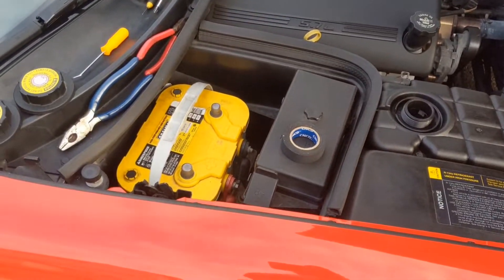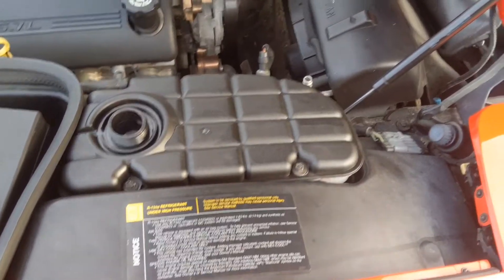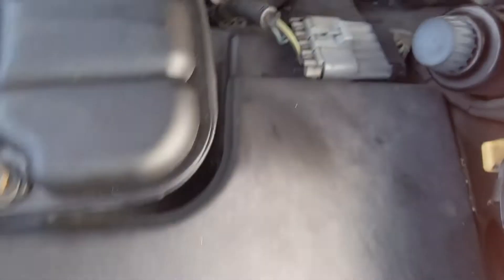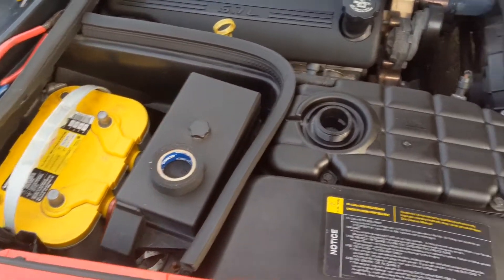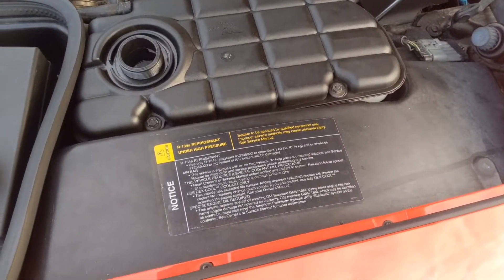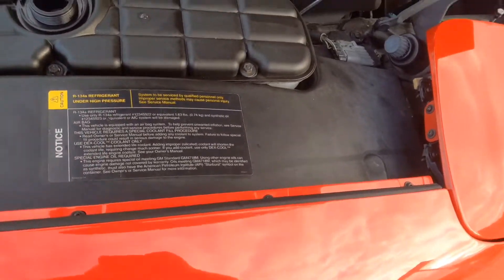Alright, I am done — pretty much, I believe. If not, I'm going to throw this car off a cliff. It's annoying. It's going to leak everywhere — I just cleaned it all and it still had a coolant leak. You can probably hear my annoyance. But it's all back together and connected. There's the new part — you can see it's all taped up. This aftermarket part from Amazon — I'm sure it's all dorman stuff — it doesn't fit. You have to pretty much mill out the inside portion where these studs go through; it's too small. I just used a screwdriver because I didn't feel like walking to the house to get my drill. You have to make those holes bigger. Hopefully it doesn't leak through there — if it does, I'm going to call them and warranty that, because it's annoying that you need to modify it just to get it to fit. But otherwise, it all works.